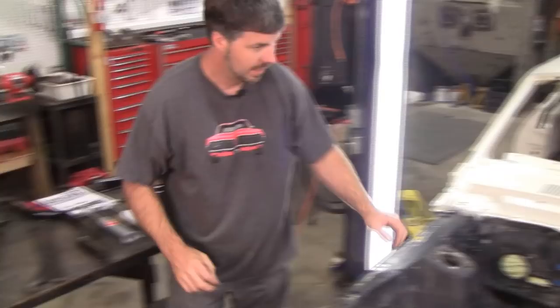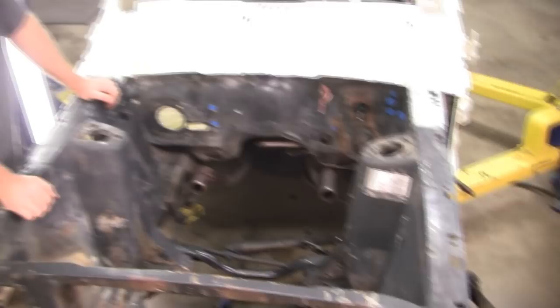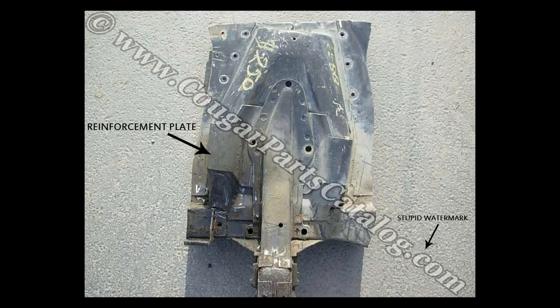Here's the next must on the '67-'68s — it helps on the '69-'70s too. But '67-'68s are very prone to cracking in the shock towers. Andrew's grandmother drove this car — a little old lady from California. She never put oversized tires on it, she never drove it hard, and still look at all the problems encountered here. Look at these welds — we've got issues going on here. In late '68 they got smart, but only on the big block cars, and did a reinforcement plate in this area. '69-'70 Cougars have that reinforcement plate too. A lot of the small block Mustangs in '69-'70s still have this naked exposed area that cracks.